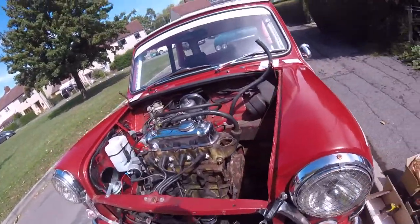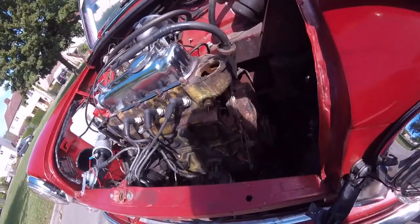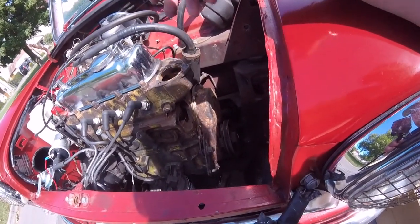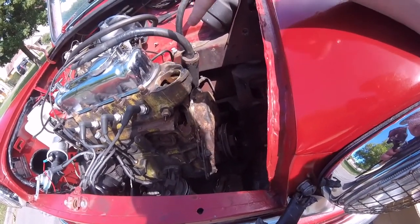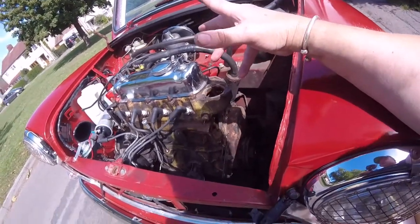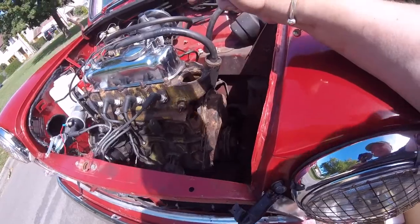Hello again everybody, welcome back. Okay, we've got the water pump out. We've got that hose up. They've took the water pump out at the moment because they got to get a new hose. We found the hose had a little tiny split in it and that's the reason why we've seen all that corrosion around the water pump, because it had been leaking for quite some time.